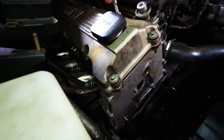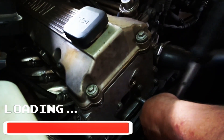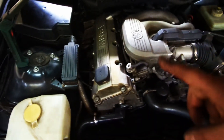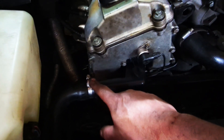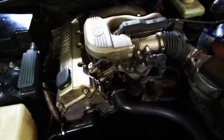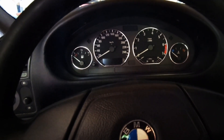I'm basically finished. I've bolted the water pump back on as well as the camshaft sensor — everything is tight, the radiator hose is back on, and I've double-checked everything. The next step is to fire it up. I pulled the fuse for the fuel pump first — I just want to crank it over a couple of times to build some oil pressure and make sure nothing is weird or making noises.